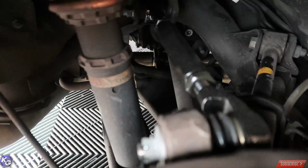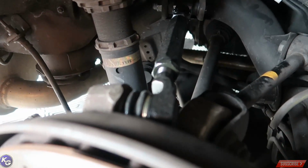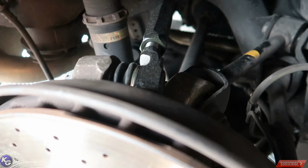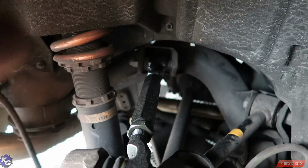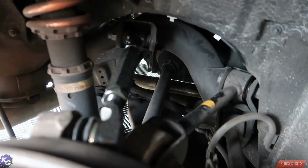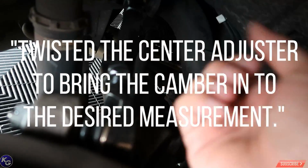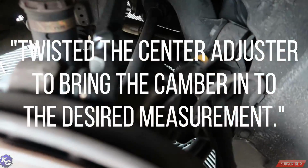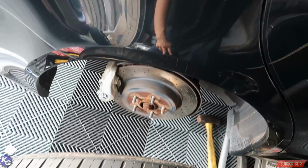But the camber arm is in, you can see. What I had to end up doing was measuring what I wanted, but making it longer than it's supposed to be so it fits all the way back there. Once I bolted the front and rear in, I just pretty much tightened this by hand and then with a wrench until it was perfectly where I want it to be. So it should be good. Now we gotta put the wheels on, so moment of truth.